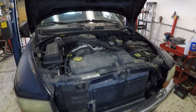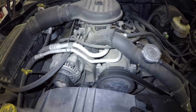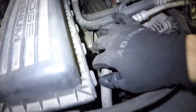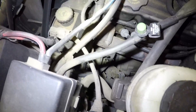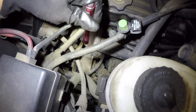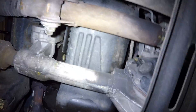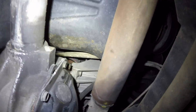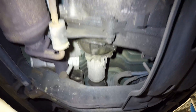On this pickup truck, for example, the engine is pointing this way — this is the front of the engine where the serpentine belt is, and right there is one motor mount on one side and one on the other. Getting underneath, here is one mount and here is the other. Right there is the transmission mount, and right there is the drive shaft coming out of it going to the rear differential.